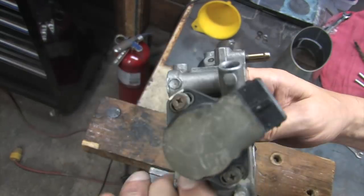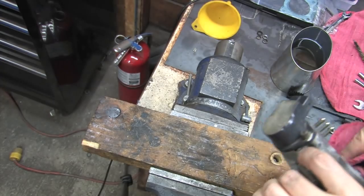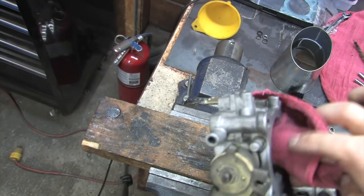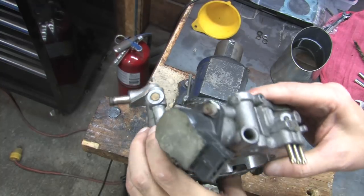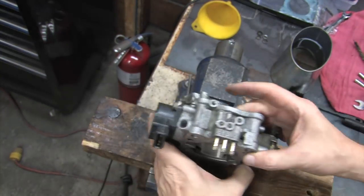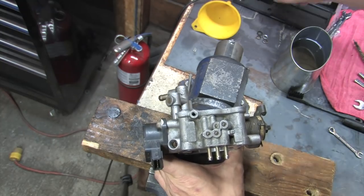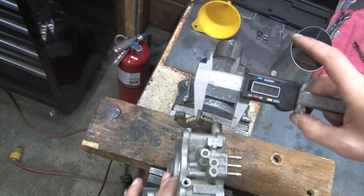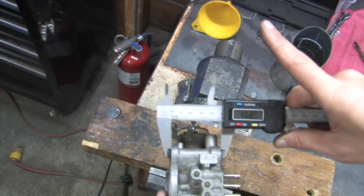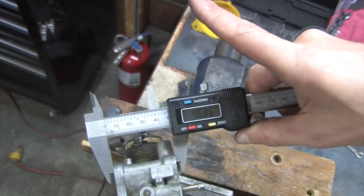It feels great. My adjustment actually helped line the throttle plate back up again with the sealant paint lines that they used in the bore when they first made it. And with all the new seals and gaskets, this thing's going to hold all of its boost in now. That pretty much wraps up the rebuild portion of all three throttle body models used on the Turbo DSM lineup. There are some physical and electrical differences between these three throttle bodies that you need to be aware of if you're building your own 4G63 powered thing that uses one of them.